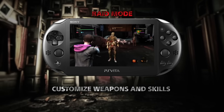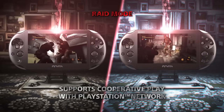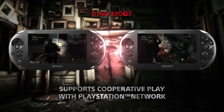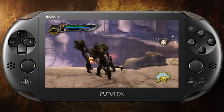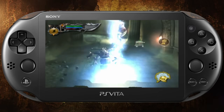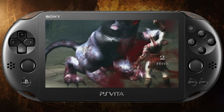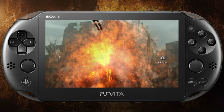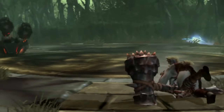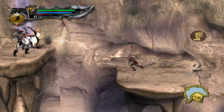Beyond its core rendering architecture, the PS Vita's PowerVR GPU also supported 2X multi-sample anti-aliasing, although whether MSAA was enabled was up to individual developers. Sony's customizations to the SGX543MP4+ also included the addition of a tuned rendering pipeline, which gave the Vita superior texture performance alongside its dedicated VRAM, when compared to other devices that used the same GPU family, such as the iPad 2 at the time.